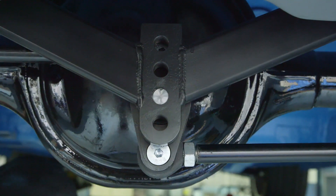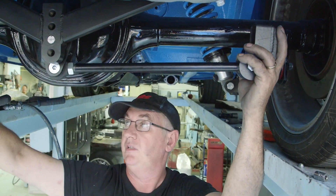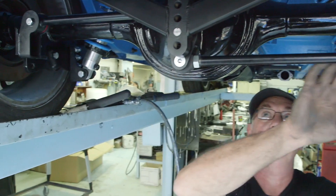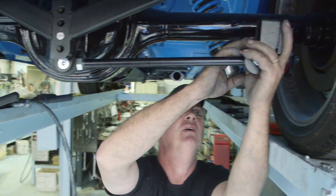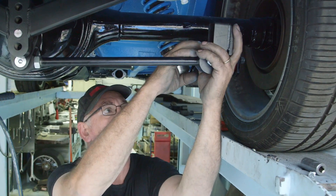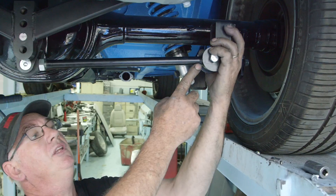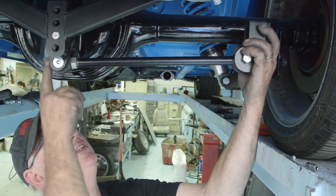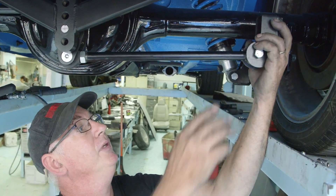You're aiming for a vertical plane in the watts linkage up-down position, and once it's set at ride height the rods should be sitting parallel — which you'll find when the car gets a fuel load and all its weight, it will be. The other thing is to make sure everything is in line: these rods need to have the same pivoting plane, meaning the same vertical plane as the watts link propeller. Then tighten the lock nuts.